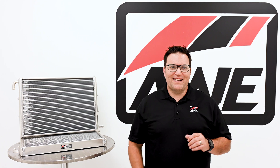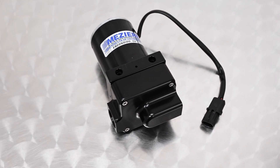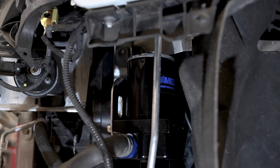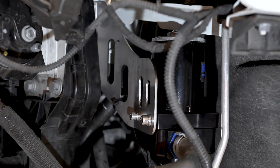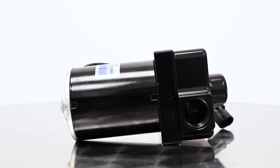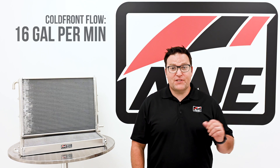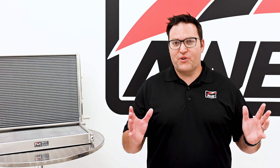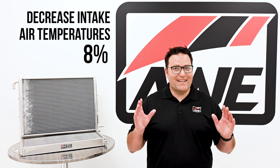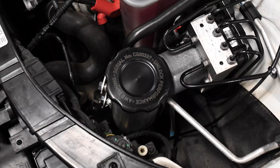The final optional ingredient to the cold front system is the coolant pump. An increase in coolant capacity from the heat exchanger and reservoir affords the ability to raise the speed at which the coolant is circulated. The faster the coolant is sent from the hot supercharger to the point of heat dissipation, the better. The cold front coolant pump increases flow by 100%, from 8 gallons per minute to 16 gallons per minute. This increase in flow allows the cold front coolant pump to help decrease intake air temperatures by an additional 8% all on its own when combined with the cold front heat exchanger and coolant reservoir.